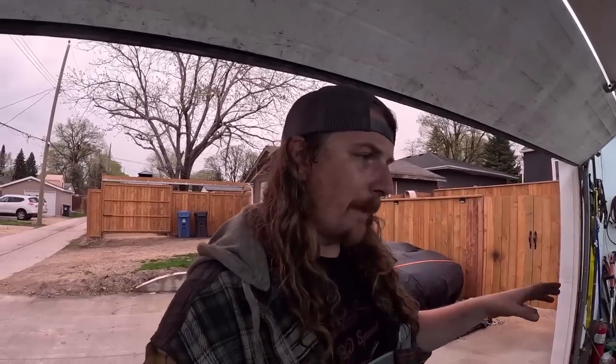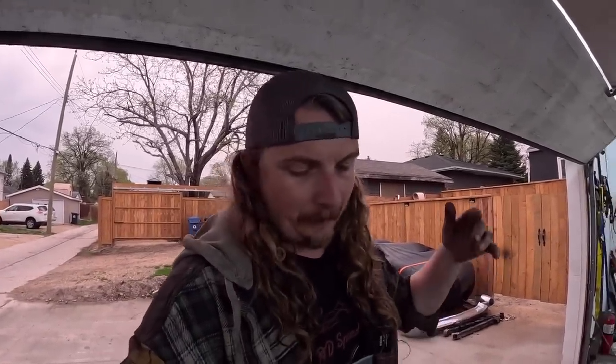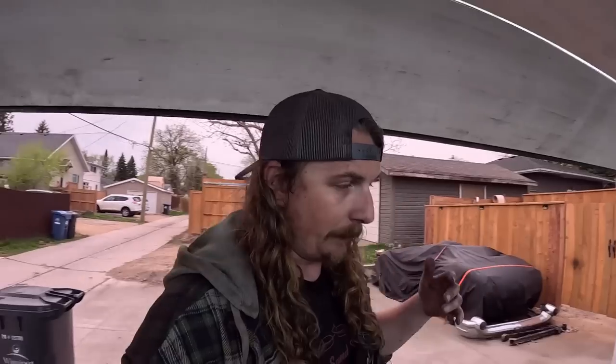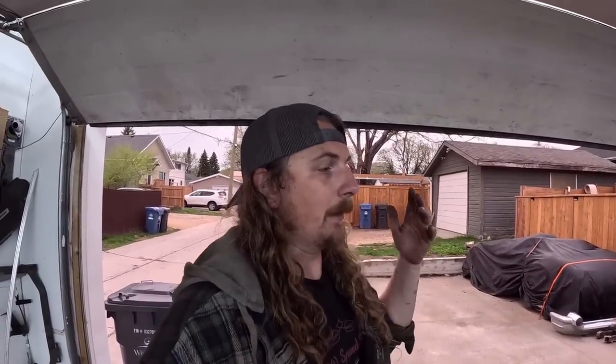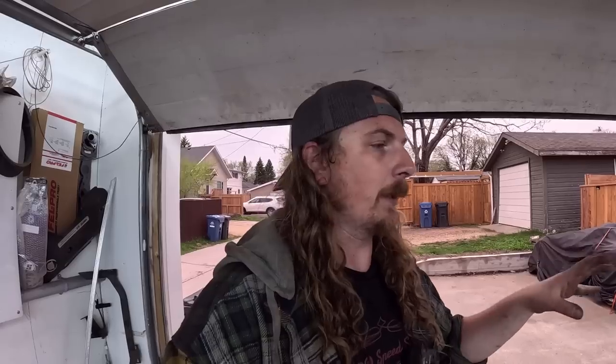I ran the valves today. This motor does have a kind of clickety clickety sewing machine noise. It does have aluminum roller rockers. Now the internet split. Some people say they make noise, other people say they don't. It has lots of oil pressure. Again, this motor, I was told it's a good motor. I trust the guy I got it from, and a lot of people know this motor and say it's good. So maybe it just is a little noisy, and that's just how it's going to be. Now, it's obviously only when you're right under the hood looking at it.